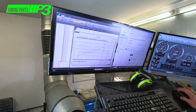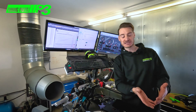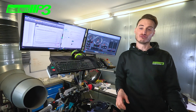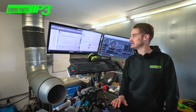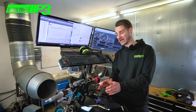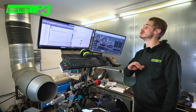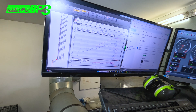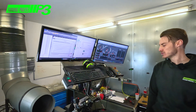Really good, and bear in mind we've only done three sets of heat cycles on this. The tire's getting soft and sticking to the drum, so you're losing energy having to peel it back away. With a rock-hard tire on there you wouldn't be losing that — it'd be another two or three brake horsepower. So we're at nearly 64, probably talking around 66 in real conditions. Nothing's been done to the bottom end — it's only had head work, slightly bigger carbs, and an airbox delete. That is mega, and it's really smooth too — the power dip at the bottom is a lot flatter now.